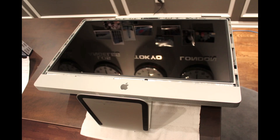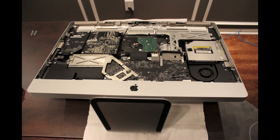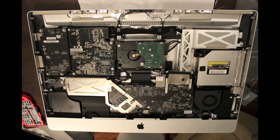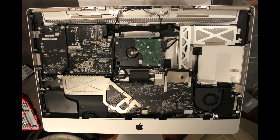The install is finished and it took quite a bit longer than I hoped. I don't have video but I'll share several photos. First, the iMac laying down on the desk with the glass front removed. Here's the screen out of the iMac and propped on a chair — I tried to prop it vertically so not much dust would land on it. Inside you can see the various components. Here the optical drive is removed and the SSD is going to go in that same slot, just underneath where the optical drive was.